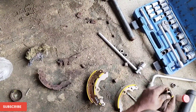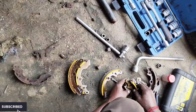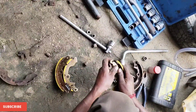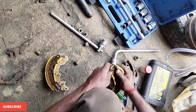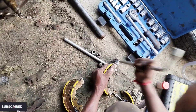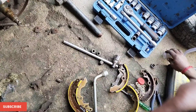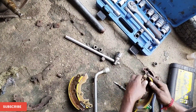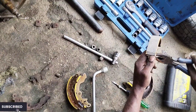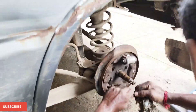In our case it came out. This is how we have to link it to the new brake pad — it's simple: just press and hold, and if you need support you can use a spanner or some heavyweight material like a hammer just to push it out like this. Once done, the next step is to put the binder clip back — the reverse process of what you did earlier. With this, one side brake pad work gets completed.